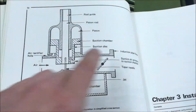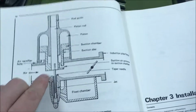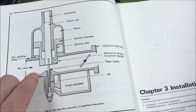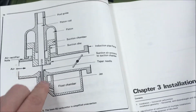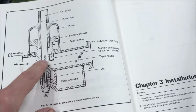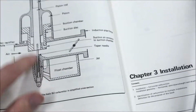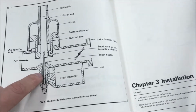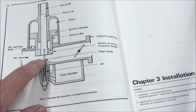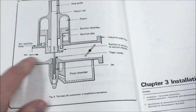But that makes sense because it has to continue flowing and it has to go somewhere, so the velocity there increases. But most importantly, the pressure in this area right here is far less than right over here, and this vacuum of sorts, this little bubble of low pressure, causes this fuel to fly out and try to equalize that pressure. It's very small amounts, and that's why it creates a vapor, because it's very small amounts of fuel, like fuel droplets, even smaller than that, and air is mixing with it.